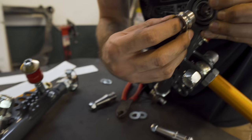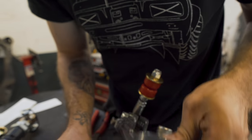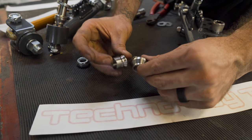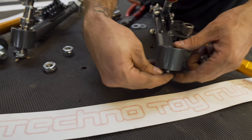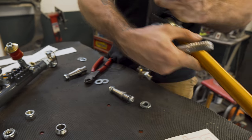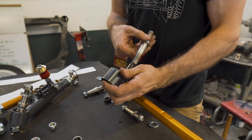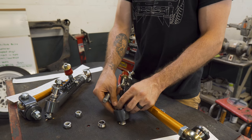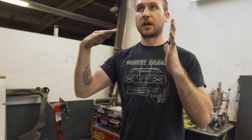These actually press into the bearing. These are slightly different than the spacers — do not get these confused. If you're putting them on, these are the only ones that actually have the diameter shaft to sit in here. So it's kind of self-explanatory, but essentially what you can do is you can change the roll center of your ball joint by stacking these differently. That's super customizable. You want your control arm to be as level as possible.